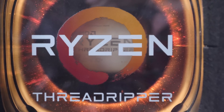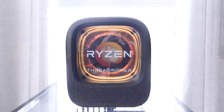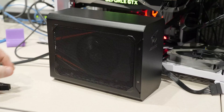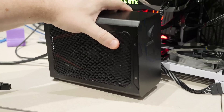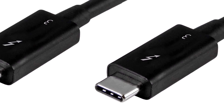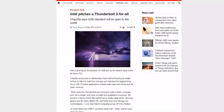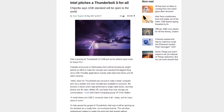So Thunderbolt — what gives? Some background. I got this Dell XPS, this is a Kaby Lake G, got four Thunderbolt ports basically. Got the Gigabyte Gaming Box; this has got a GTX 1070 in it. This is a really popular setup — you can get a laptop that has only an iGPU or a relatively weak integrated GPU and you really want to play some higher-end games. You can get a dock like this with a real graphics card connected via Thunderbolt 3. It's a 40 gigabit per second connection, or PCIe x4 if you want to think of it that way. Thunderbolt has exclusively been the realm and domain of Intel forever, but Intel promised to open up and release the specs for Thunderbolt 3, and they pretty much have. But Intel still wants to certify Thunderbolt 3 devices.